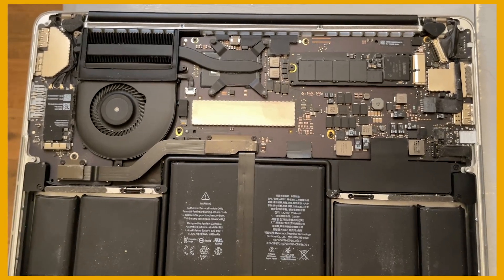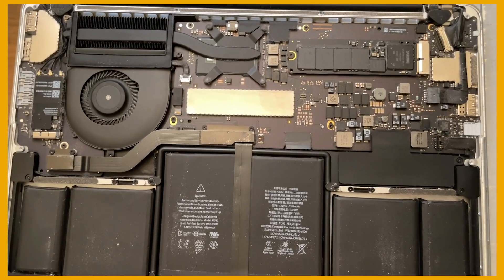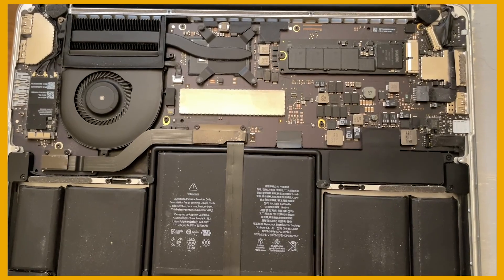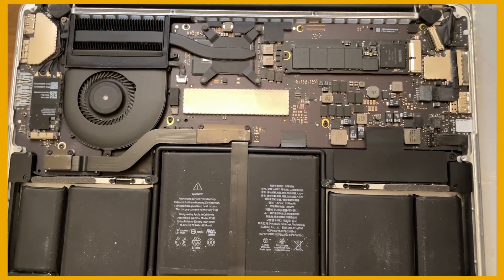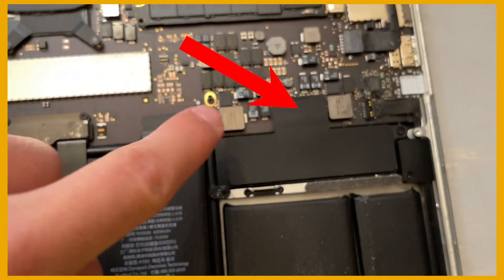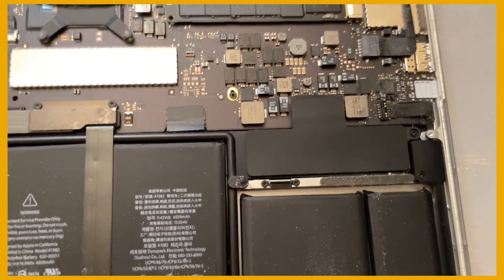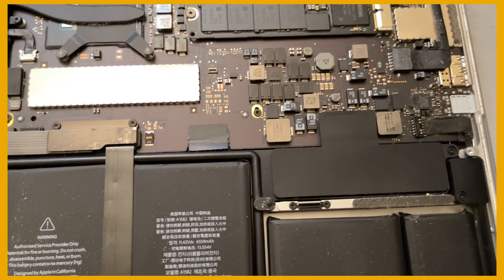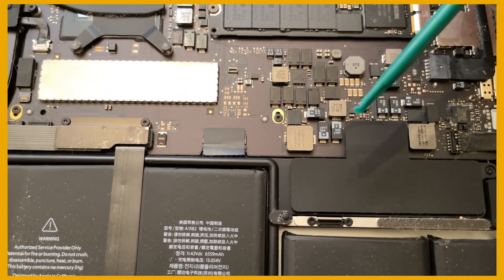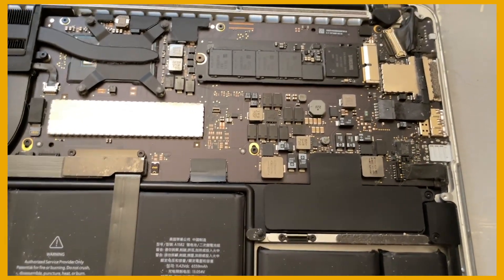The first thing you're going to have to do is take the back of the computer off, and you'll need a special type of screwdriver. You can get those on Amazon — I'll put a link in the description for which screwdriver you'd need. The first thing you have to do is disconnect the battery from the logic board. It's this little piece right here — you just get under there and peel it back and it pops out. I used a little pry tool that usually comes with screwdriver packs. I got right under there, peeled it off, and once it's off, you've disconnected the power.